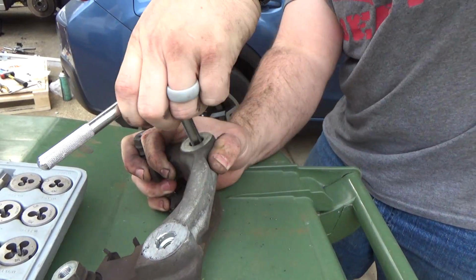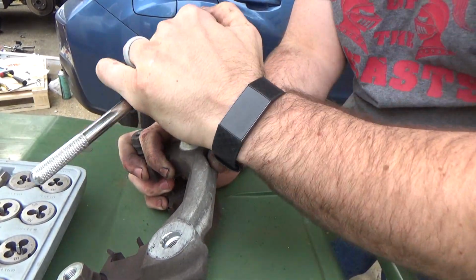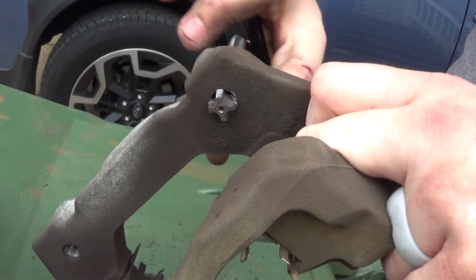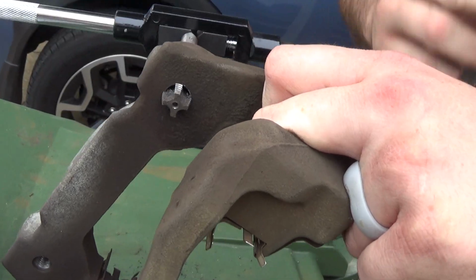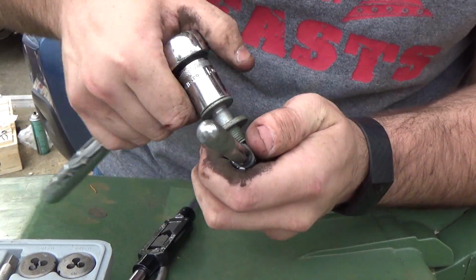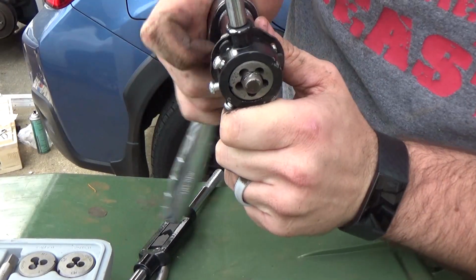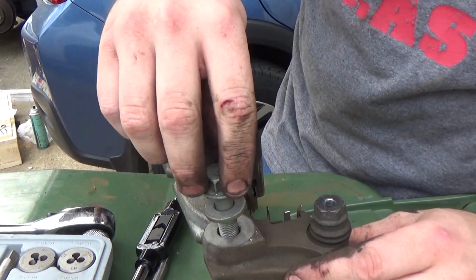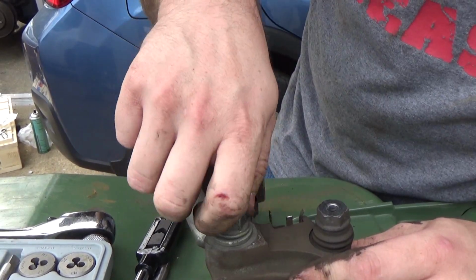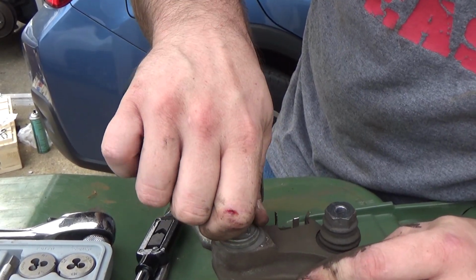As shown, the passenger side brakes had some issues as well. I re-tapped the caliper bracket and I chased the threads on the bolt, but when we mounted the caliper back and tightened everything down, there was a noticeable bend in the bracket, which would cause the brake pads to wear unevenly and more than likely warp the rotor again. So we had to order a new part. It's a dealer part, by the way, to make sure the vehicle was safe and to prevent further braking issues.